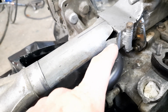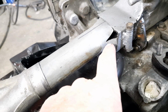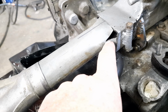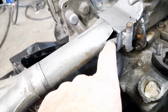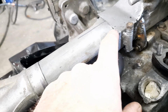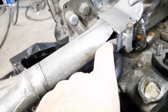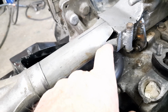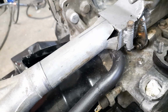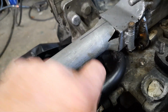Yeah, I've got an old brass tap that I'm going to fit the brass up inside there and clamp it, wedge it, something like that underneath, and that'll keep a bit of a rounded profile, so then I should be able to just do a continuous weld and not get any pinholes in it. And I'll do all that. I'll fill all these in.